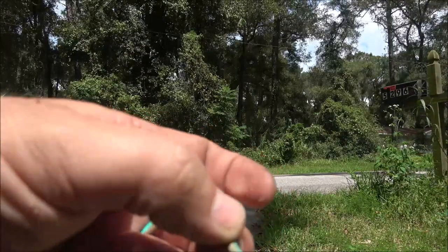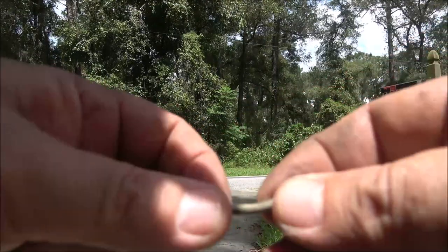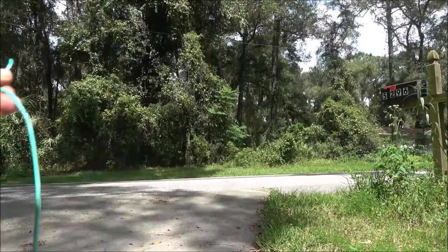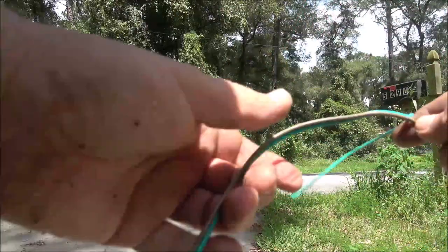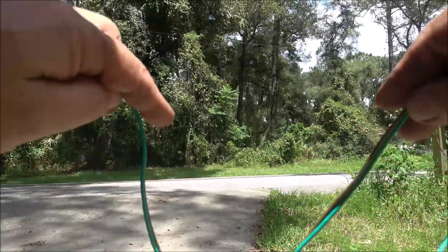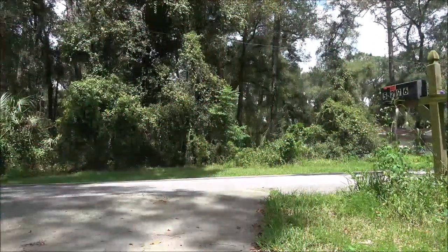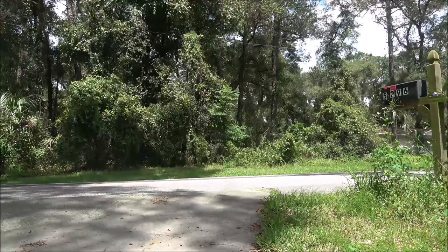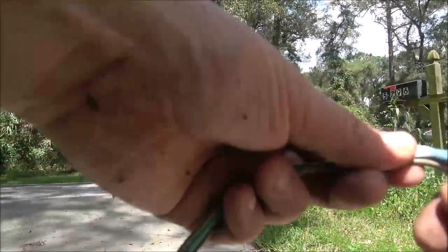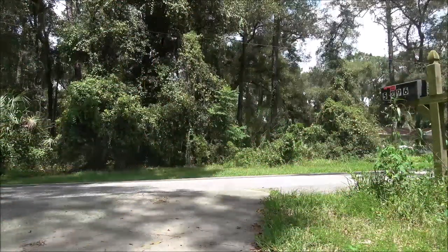This is what I wanted to show you. See how it's all white in there? That's because water got in there and what that does is start eating it all the way up through your wires. You'll start putting a patch in that wire and the next thing you know, now you've got two places for it to corrode, then more and more. I'll show you what I do to stop that. Up here at the top, this is called the pigtail - four-way flat - and it's still good up here. I'm going to cut these and I'll save this four-way flat for another project.